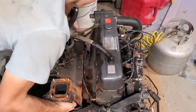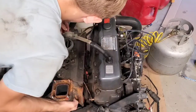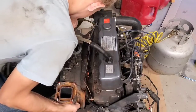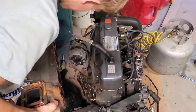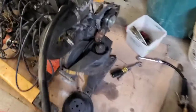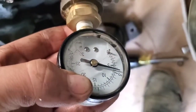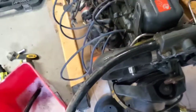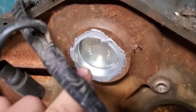After a while I tested the block by pressure testing it, and the freeze plug was the problem. I needed to put in a new one with some sort of sealant because it was pitted. Here you can see the pressure going down. After putting in a new one with sealant, it held pressure just fine, which showed me that the block is good and I don't need to buy another one. I just put in a new freeze plug with RTV.